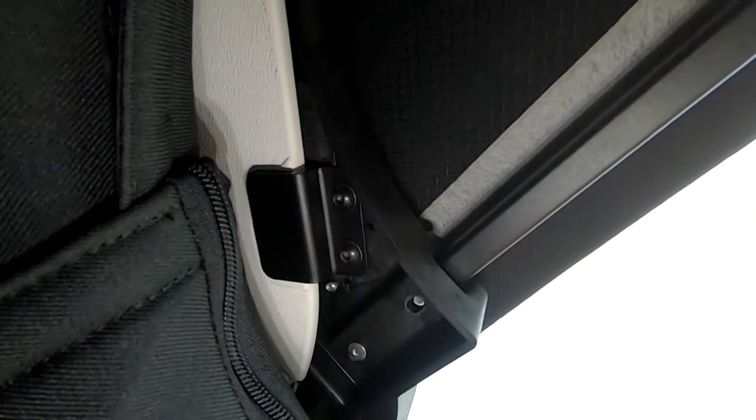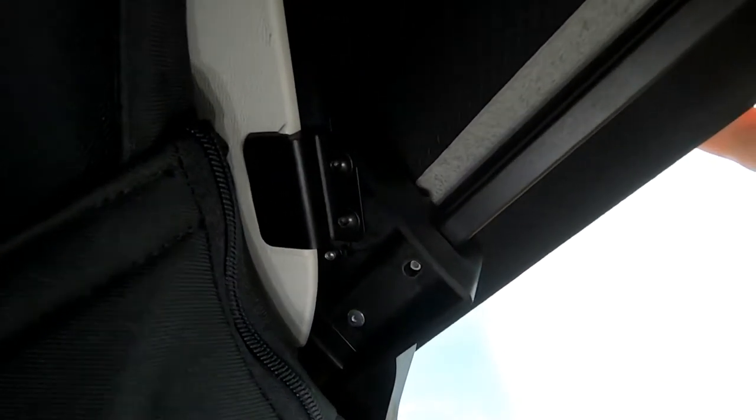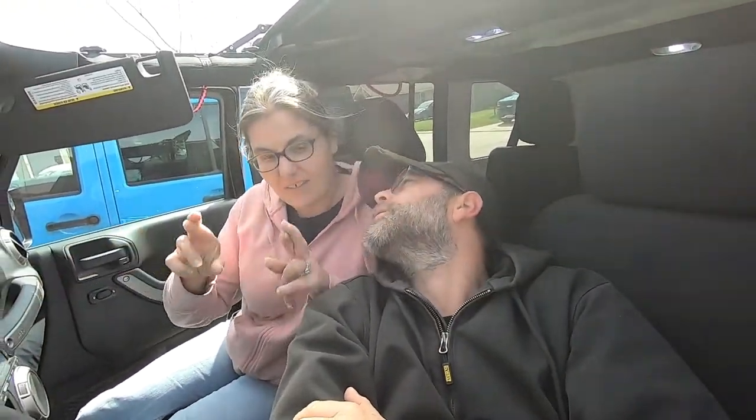All right, so right up here above my head — let me show you. I'm going to take a drill bit and try to drill right into the center of that thing. I'm not going to press very hard because I don't want it to go through the Sunrider, but if I could just drill that little bead out on that rivet I can get it to fall out, and then we'll try to pop a new rivet in it. Fingers crossed.